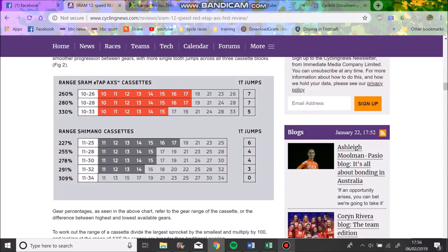I'm just not sure a 10-tooth is necessarily the best way to do it, because it's not going to be very efficient. There's a reason why pro riders run 58-tooth chainrings - it's not because they're spinning out on a 54/11, it's because you get a more efficient chain line. It's better when you have bigger cogs - a 58/20 is better than a 54/16 from an efficiency standpoint.